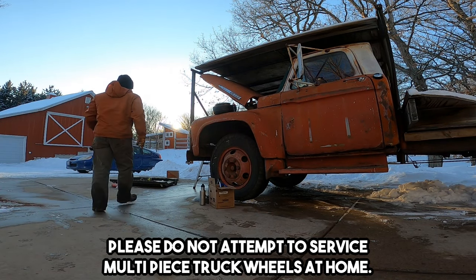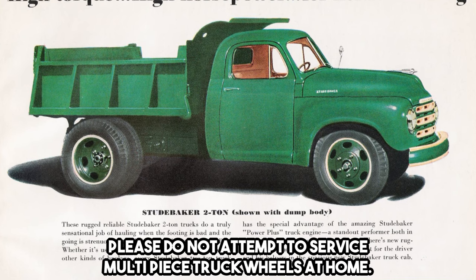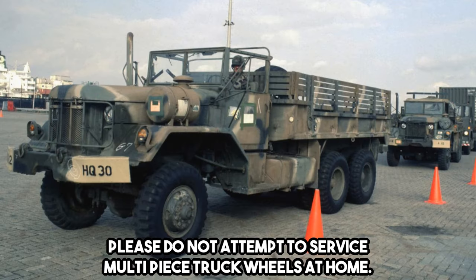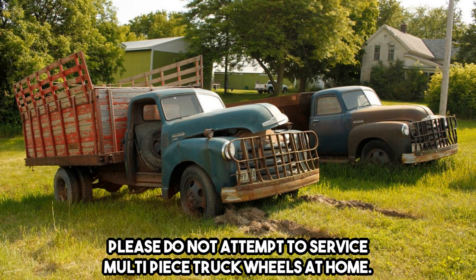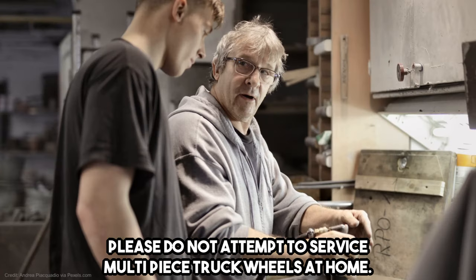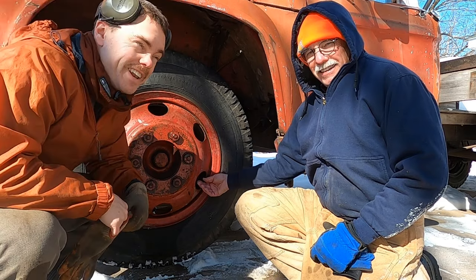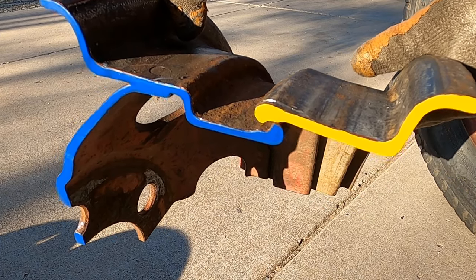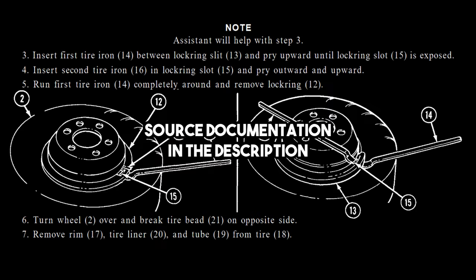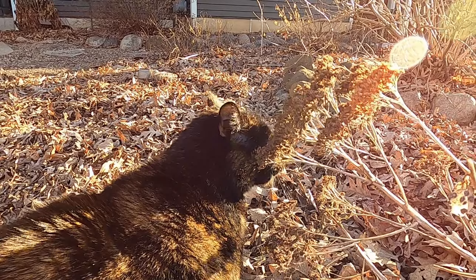The big asterisk some people add is that technically RH 5-degree Widowmaker wheels still exist, and OSHA lists recommended procedures for mounting tires on them. However, this doesn't mean you should try it — these wheels have killed many experienced professionals, and safer Army surplus split-ring wheels are relatively cheap. No one at a car show will be able to tell the difference once they're painted. But if you're super hardcore about absolute originality on an antique truck, you should find someone who personally worked on these back in the day. In this video we covered historical information about common multi-piece truck wheels, tips for removing them, and a real-life example of what makes RH 5-degree Widowmaker wheels so dangerous. I'm linking all my source documentation in the description — please check that out. Thanks for watching, and press on.